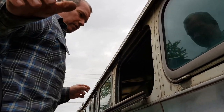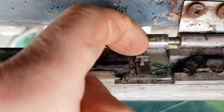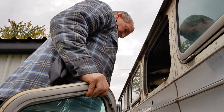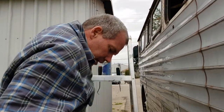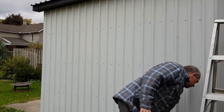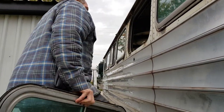If you're watching the camera I'll show the actual clip. So this little clip right here — I've got it lifted up right now out of the hole, but it actually pops down into the hole to lock it in place, and you can see it's starting to separate. And that's how easy silver side windows come out. So now we've got the whole window out, I can go work on it on the bench and I'm going to put my replacement one in. Then we have one good window that we can rotate through once we're done rebuilding it.